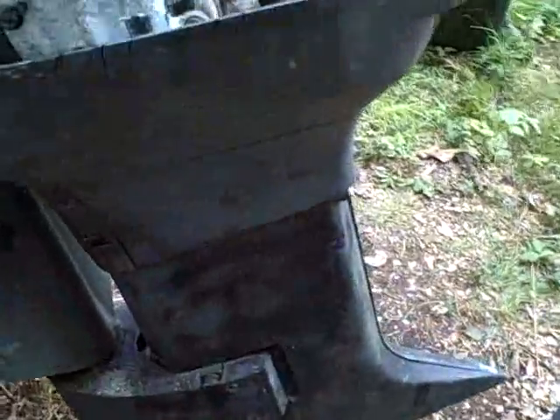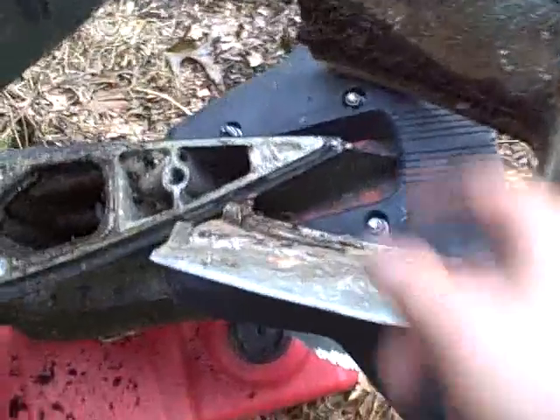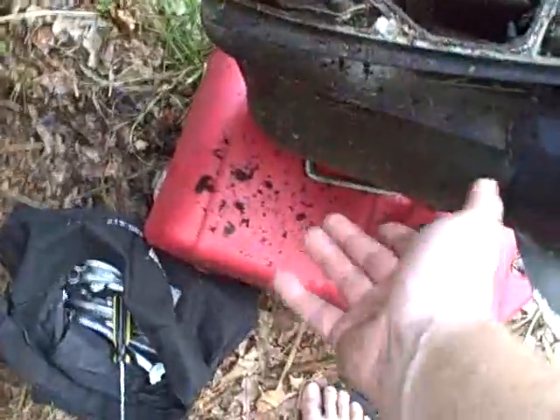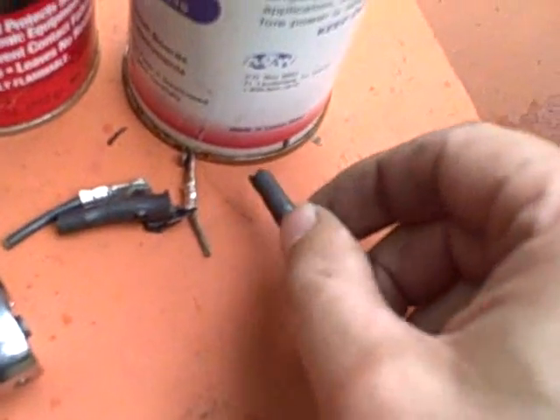You can just see the powder corrosion coming out with the screw. I'm having trouble getting this piece off in the front - I figured I'd take the back off. I look inside and I can see there's a screw there and a screw there, so if I get those two screws I can drop this whole back piece off. Stuff is already falling out - mouse droppings and everything. I had been working so hard to vac out down in there and couldn't get to a lot of it - it had collected down inside. I used heat to get the remaining screw out, pulled off the back piece, cleaned in there, and can see that the wires go through a hole in the case and into the upper gear case. Once I removed the heat shrink tubing and rubber coverings and disconnected the quick disconnects, I was able to easily fit them through.